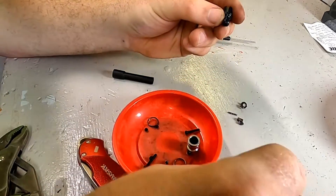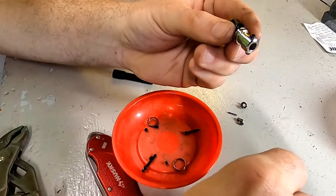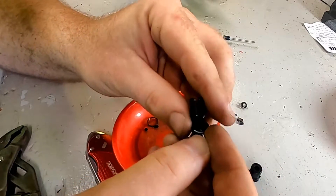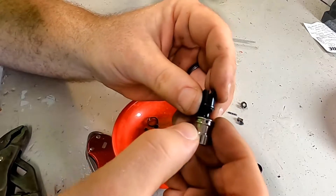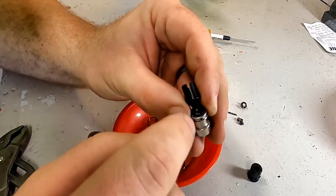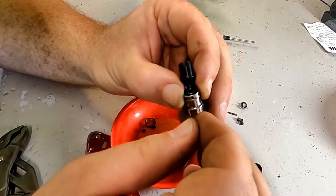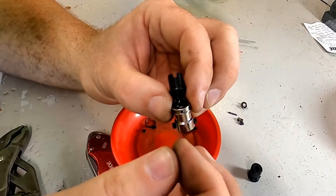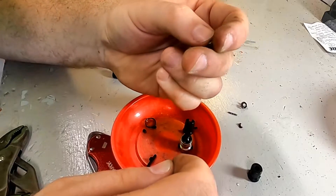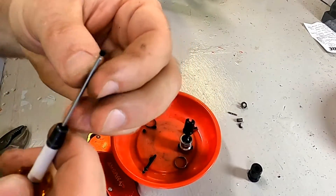You can see it actually has a cross pin hole in it here. As you put that through, you will have the hole that goes through this whole thing, then lines up into here. This pin goes into here, goes across and all the way through — that is how that junction is made. Right here is an open spot where one of these set screws will go in and help hold that pin, which is a nice upgrade versus the WL Toys version, which is a solid piece.